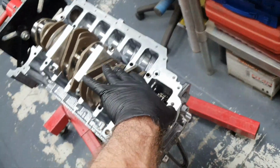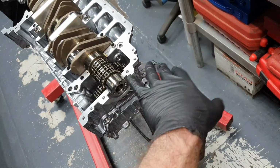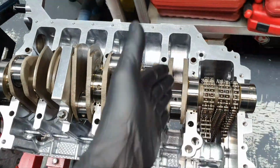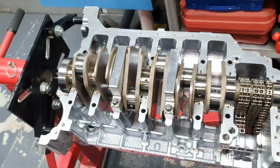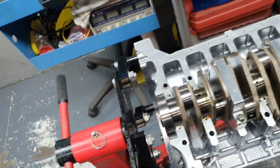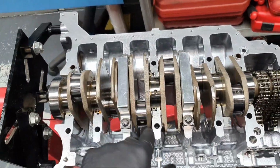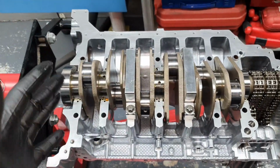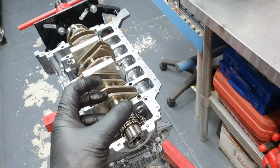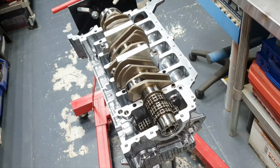Why is this happening now? Because now the engine, I'm gonna make it, it's not upside down, this is supposed to be on the side, okay? I have to make it looking up to enter inside the pistons properly, and then I have to install the other connectors from here, and I have to hold it up. It's a different procedure, that one. One tool is gonna be attached here to hold it up one at a time. Somebody will also help me to keep it in place, to not scratch the cylinder wall. It will not scratch even if you touch the connector rod, but just to be safe, I have also the plastic net to dress the connector rod, so it's the plastic instead of the connector rod if it touches.